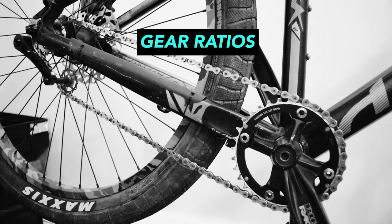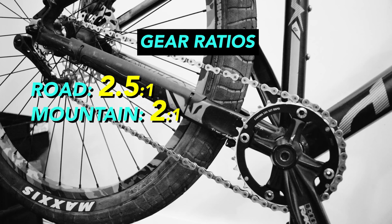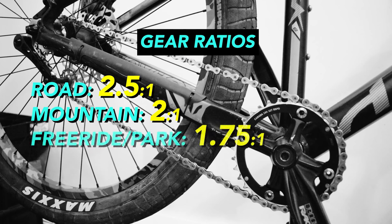Higher ratio makes pedaling harder going uphill, but will get you higher top speed with less crank spinning. It's great for long distance and downhill riding. Lower ratio gives you easy pedaling and faster acceleration at low speed. It's great for uphill and park riding.